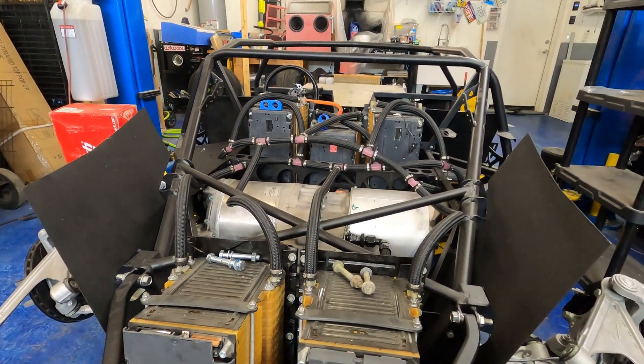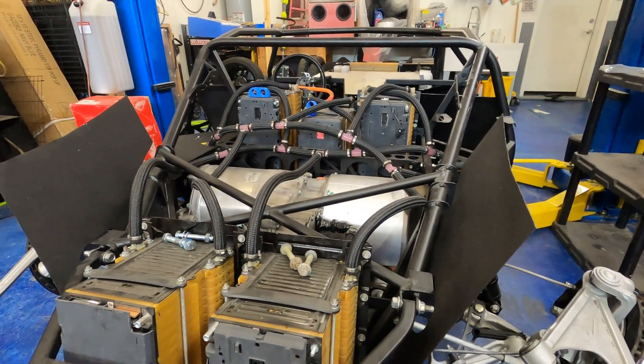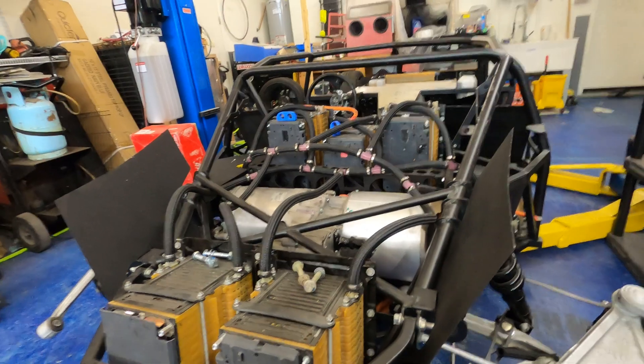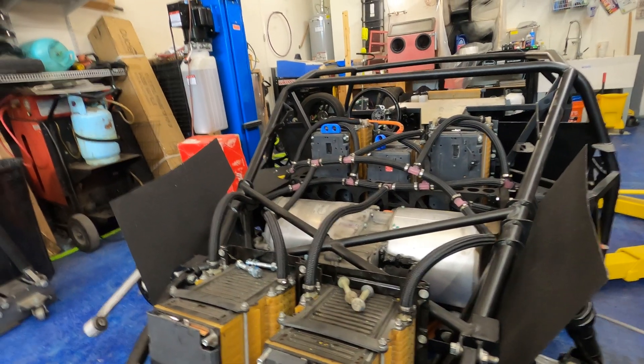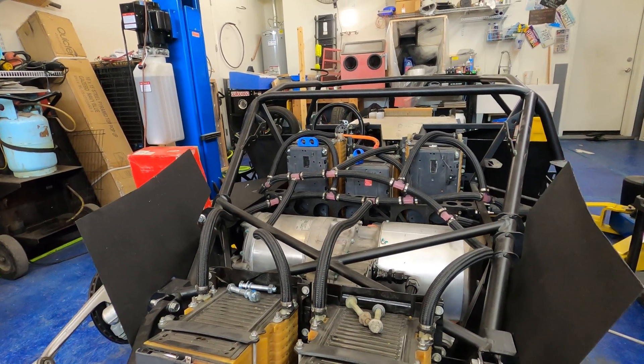This is the sport rear-wheel-drive unit, what they call the 'big drive unit,' out of a 2012 to 2016 or 2017 Model S. It's 400 kilowatts rated, which means about 540 horsepower and 600–700 foot-pounds of torque depending on the controller.